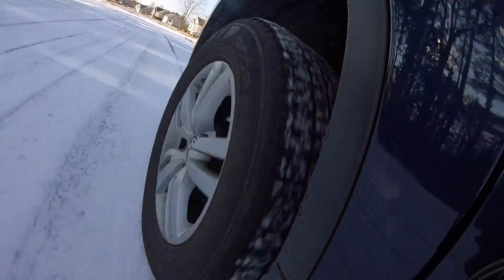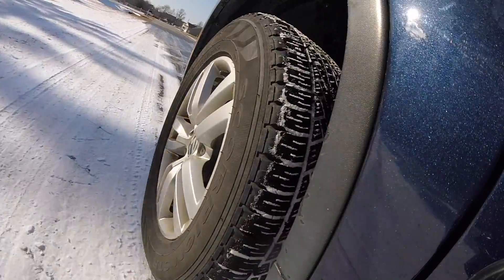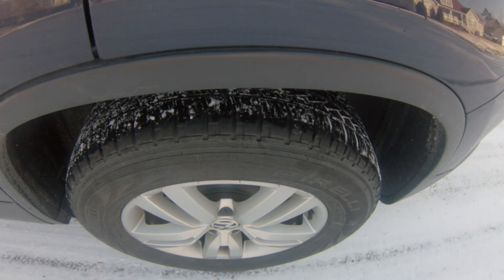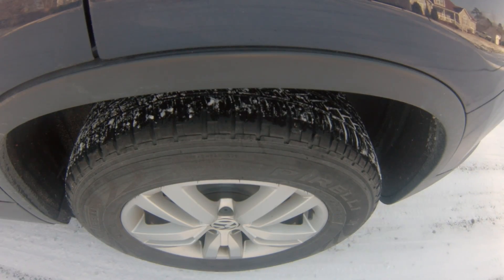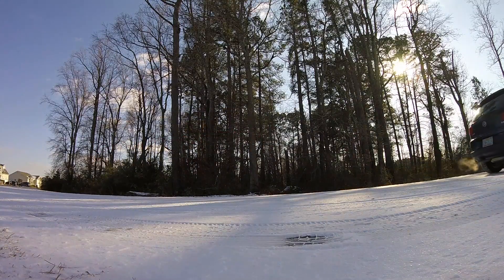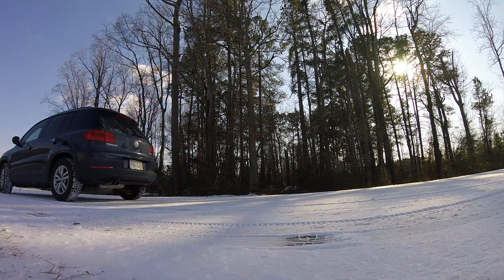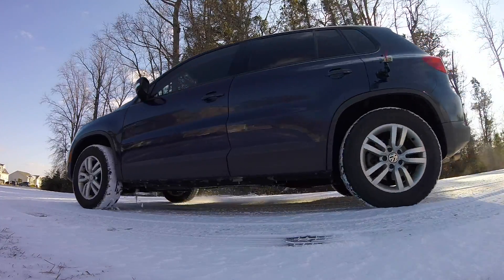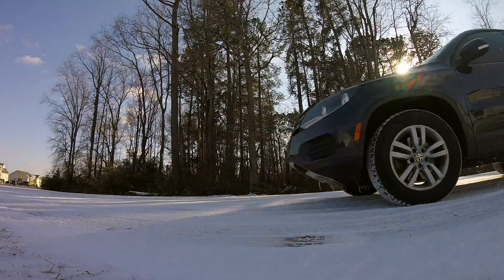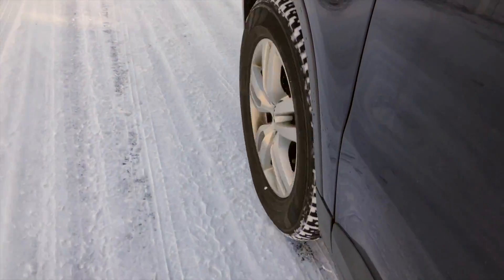So there we have some very anti-scientific testing done on the Tiguan — mostly just an excuse to get out and play in the snow. But it was interesting that it would activate the parking brake while the vehicle was still moving. That's actually normal; the threshold is about three miles per hour, but on that very slick surface it allowed the vehicle to keep sliding. Please don't do this on public roads — this is a private road. What we did today could be very dangerous. Just be careful out there. Thank you so much for watching and I'll see you next time.